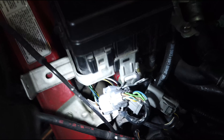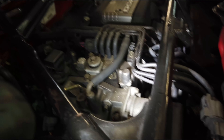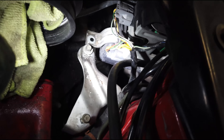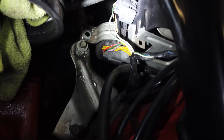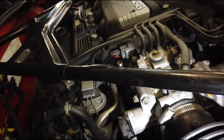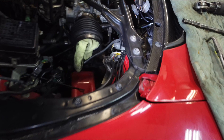As far as the fuse box goes, I took off all the brackets so it's loose, but I had to go underneath to get off these two plugs down there. Jumping over to the throttle body — it has these secondary air injection line fittings here, and they're all numbered. I'm trying not to disconnect individual things if I don't have to. I undid that bolt and I'm going to see what else I can unplug and unbolt. A lot of the plugs on this car are brittle plastic — 25 years old with a lot of heat cycles on them. I've got to be gentle and try not to break anything.